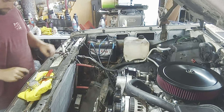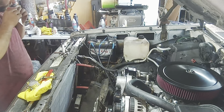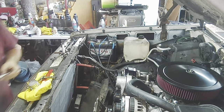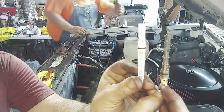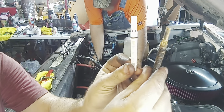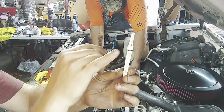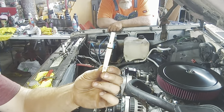This one has a black O-ring already on it. So I think all that green black O-ring crap. This was supposed to be a retrofit system. So new and old there. Yeah, definitely needed to change that. So don't do your AC without changing these out. And this thing was a pain in the butt to get off, y'all remember. So I'm going to put a little bit of the PAG oil here, one, so I don't rip this O-ring, and two, to make it easier to install.